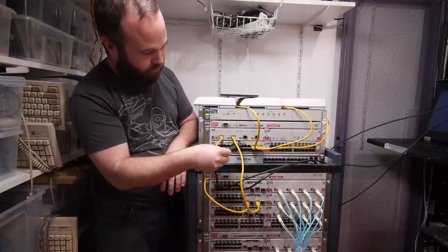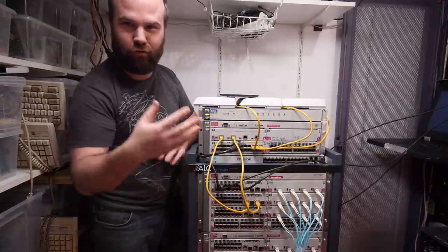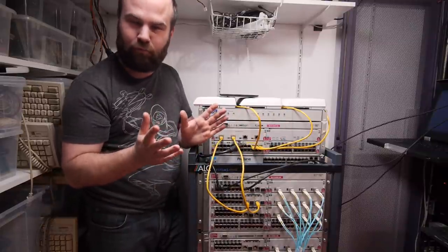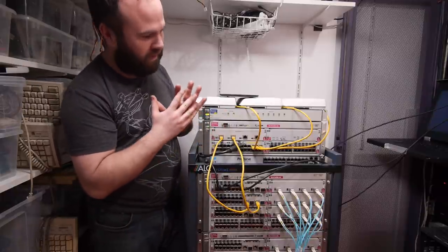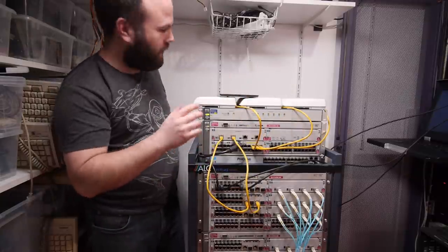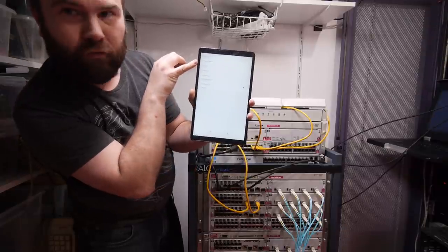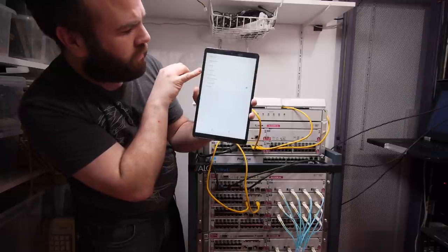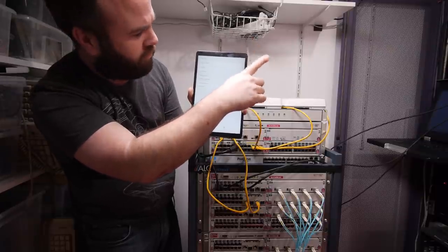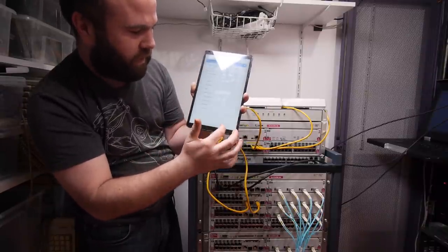The HP 5304 with the WiFi module is now up and running. It is a little bit overly complicated with the power supply for the Power over Ethernet and a separate module. You need to have a very old web browser to configure it from the web menu - you can't do it from the console. But they have a really good 45-page PDF on the HP website that explains everything, including troubleshooting. I now have 3 access points connected, all working. On my tablet I can see a 45Mbit connection with WPA2 security and an IP address from my PFSense box.